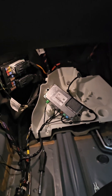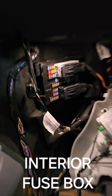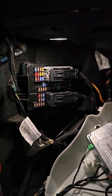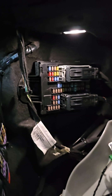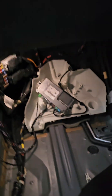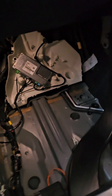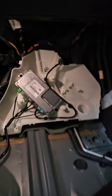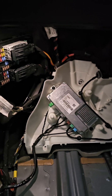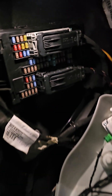This is the co-passenger side and as you can see this is the interior fuse box or the co-passenger fuse box. To get to this you also need to get access to the entire floor paneling — you need to remove the sound insulation, remove the co-passenger seat, which is actually very difficult. A lot of labor hours are required just to get access to these points and check these fuses.